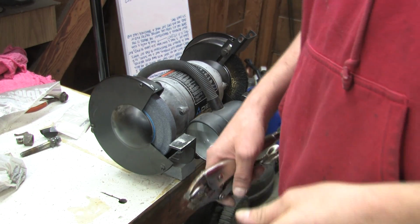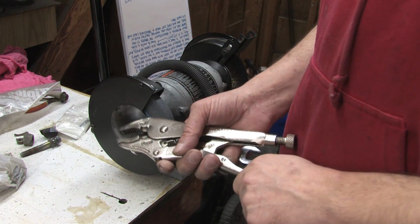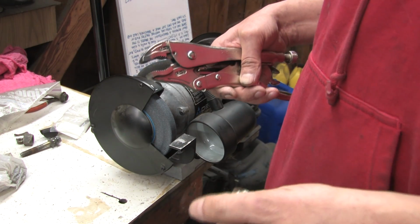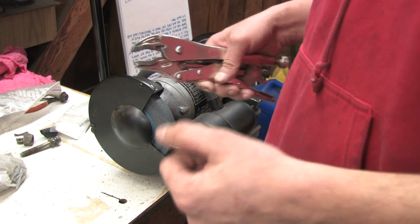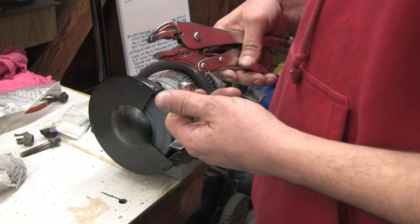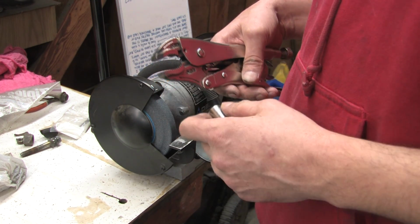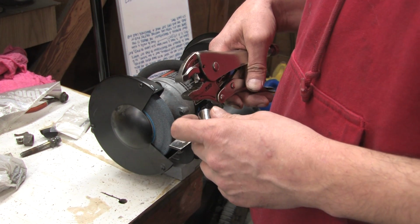So the clutch plate is seized on the input shaft. I cannot get that thing off. I have everything free from it. I can even pull it back from the dowel pins and rotate it a little bit. But I don't have any recourse now but to remove the clutch while it's all still bolted together.